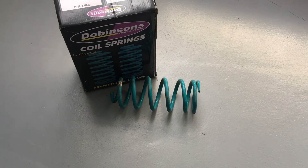In the 150 Prado with a bull bar — these days there are a lot of 150s around, they've been out since 2009, and the suspension is basically the same throughout. The most common spring: if you've got a steel bull bar without many other accessories, or a steel bull bar and dual battery as a touring vehicle, you probably want a 350 in the front. Easy to remember — a 350 in a 150. If you add a winch, lights, a bash plate, or any extra weight, you probably want to go to a 352 — it's five mil longer, giving about 10 mil more lift.